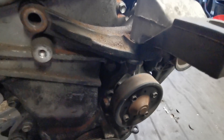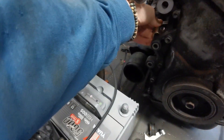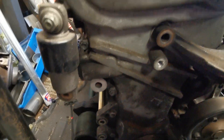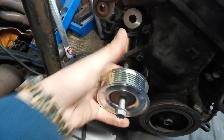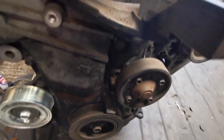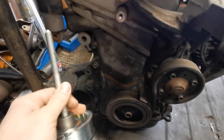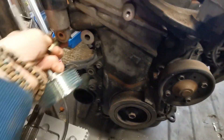You can see if I put this like that, it replaces the pulley and takes a serpentine belt. The only issue is that would crush up the block, which is why there's this little spacer tube — and that just slots nice and snugly like that. It's a bit ugly but it works. Just like that — deleted the power steering. Now if anyone on here knows anything about the Yaris, could you tell me how many turns the non-powered racks are lock to lock?